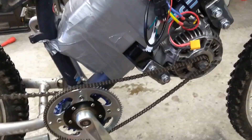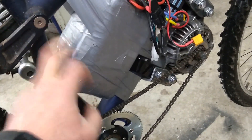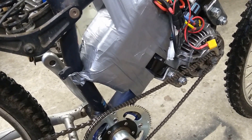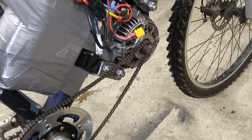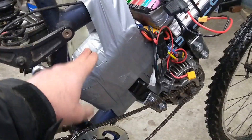I still have to tidy up a few other things. I've got new batteries coming to increase the battery capacity. This is currently 5 batteries in parallel, 10 in series — a 36 volt nominal, 42 volt max battery pack. I'm going to bring that up to at least 7, maybe 8 batteries in parallel, keeping it at 36 volts, to get the extra power. The voltage sag is quite significant — it's a 1500 watt controller up here, so it's quite a drain on the batteries. With a 250 or 500 watt motor that pack would be fine, but not with this.